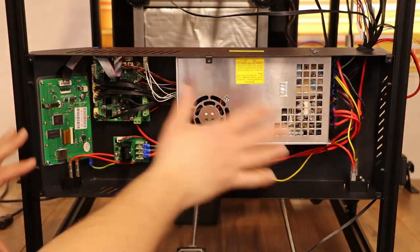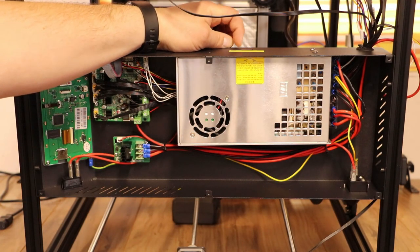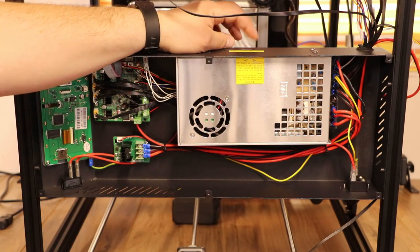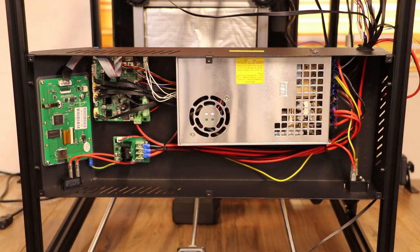If you are here just to install the power supply, you're done. All you have to do is put your back cover on, plug your fan in, and put the screws in — that's it. Don't forget to flip the little voltage switch to make sure you're on the right voltage, either 230 or 115. I have it set at 115. Put it back together and you're good to go.